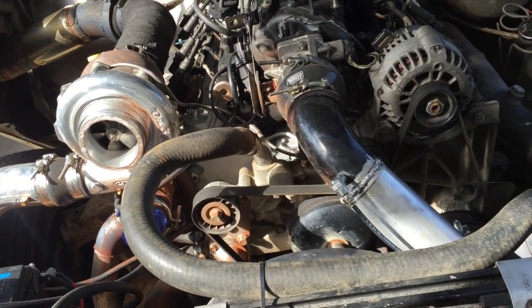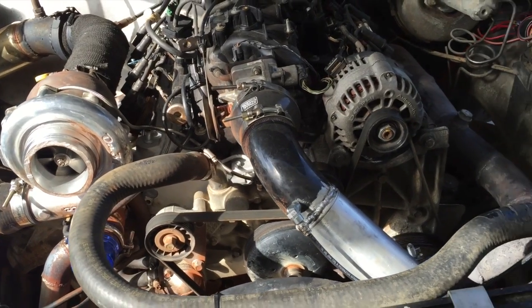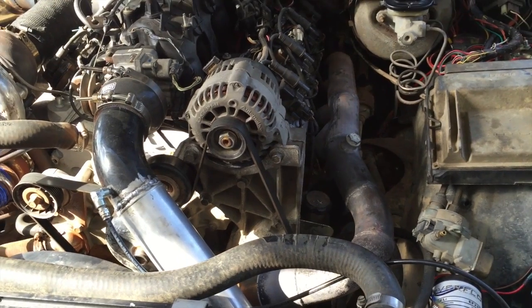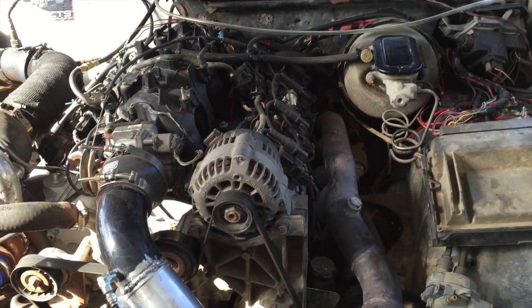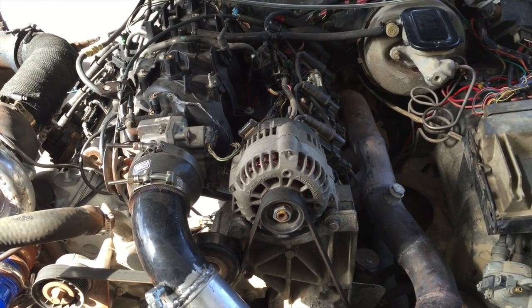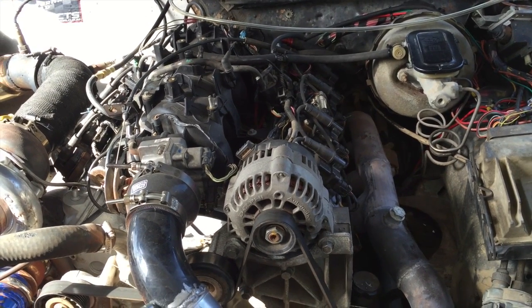Another pass, cleans up a little bit, take another 10% out. It's fat, like burying the wideband fat. Have no idea why it is. Looking at the logs, no idea. So we just keep pulling fuel out of it. So I end up pulling like 20% of fuel out of the tune to finally get it to clear up. It's around 10.8, 11.2. Seems to work okay.